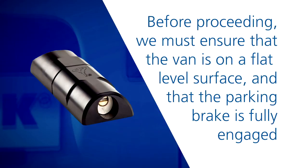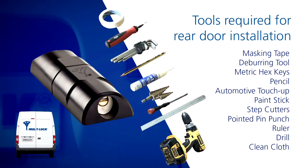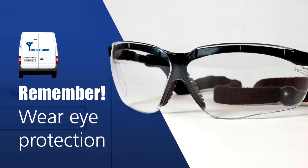Before proceeding, we must ensure the van is on a flat level surface and that the parking brake is fully engaged. To complete this installation, these are the tools that we will require: masking tape, a deburring tool, metric hex keys, a pencil, an automotive touch-up paint stick, step cutters, pointed pin punch, a ruler, a drill and a clean cloth. During this installation, our installer will be wearing suitable eye protection when using the drill.